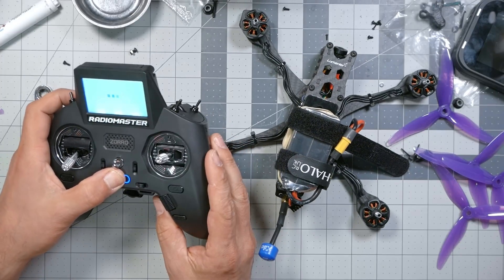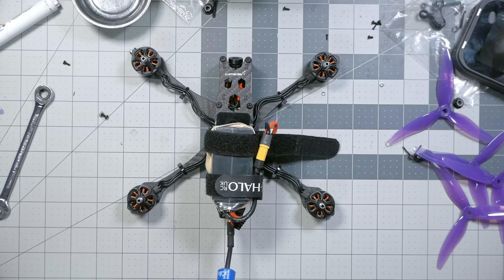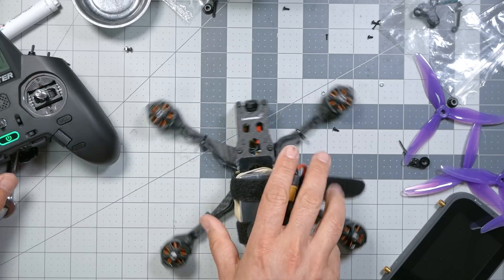As you're cinching that down, make sure you're not putting tension on the wires and pulling on them — some of this is going to move in a crash, and if it's already under tension, you could damage something. Next, grab your controller, power it up, and plug in the battery. We're going to do an arm/disarm check and a failsafe check. Note: with ExpressLRS, if you power up the receiver first before the controller, after about 30 seconds the receiver will go into Wi-Fi mode, and you'll have to power cycle it to get it to bind.